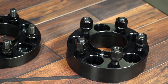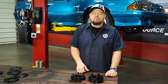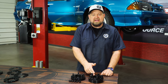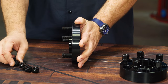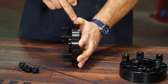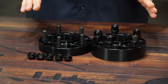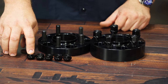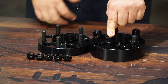If you're really looking for clearance or an aggressive look, the bolt-on spacer is going to be the way to go. These are very popular with the late model crowd — the 20 and 25 millimeters are really popular with S550 Mustangs, and we also see a lot of these for the Focus and Fiesta guys. Shown here is a one-inch version and an inch and a half version. You take the spacer, put it on the factory studs, take the supplied lug nuts, and bolt the spacer to your factory studs. Then your wheel goes on the threaded studs with your factory lug nuts. When you bolt these on, torque the nuts to your factory spec. For the smaller spacer, the nuts are smaller — get those to about 100 to 110 foot-pounds. For the larger ones up to an inch and a half, you should be able to reach your factory spec.